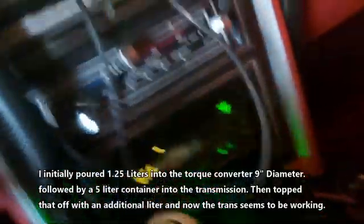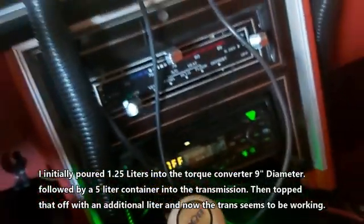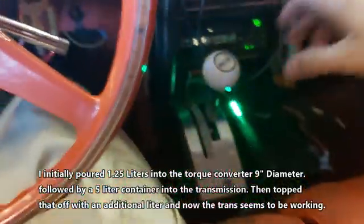Anything less than an eighth of a tank and those lights come on - pretty cool. Also, on the Terminator X-Max, I had to top off the transmission fluid. I wasn't getting movement, but watch - going into reverse right there, you can hear and feel it, RPMs drop a little bit, and it actually moves. When I had it in drive before it wasn't moving forward, but now it's pulling. The reason was low transmission fluid on initial start - I had to fill the transmission lines and cooler.